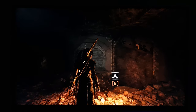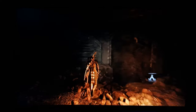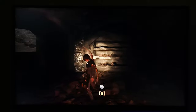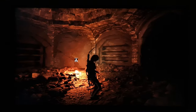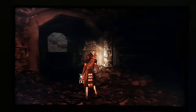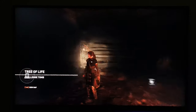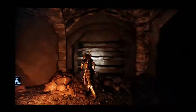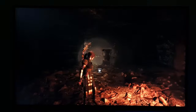I'm now on Shadow of the Tomb Raider exploring the contrast performance. This one has an IPS-type panel with a specified contrast of 1000:1, and I recorded just a smidge below that using my test settings. Natively it's closer to 1150:1 depending on adjustments. Either way, this isn't going to give you a deep atmospheric look to dark scenes, particularly if you're sitting in a dark room. But it does give you a bit of an edge over some IPS models — competing models with LG's Nano IPS panels tend to be closer to 700–800:1, especially after colour channel correction.